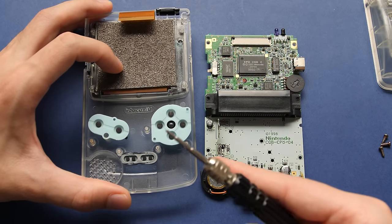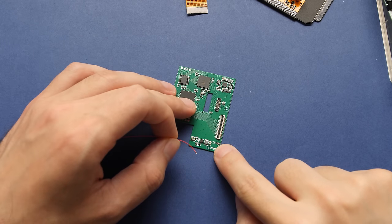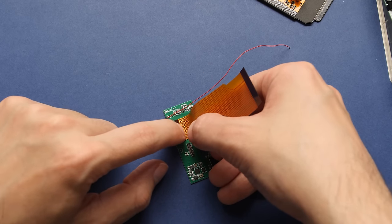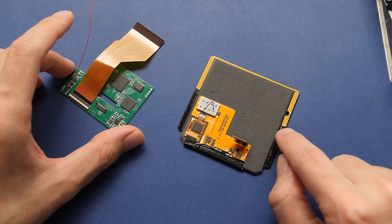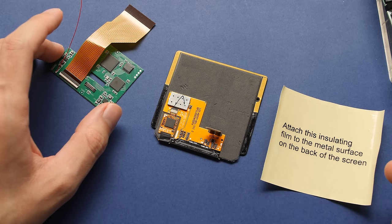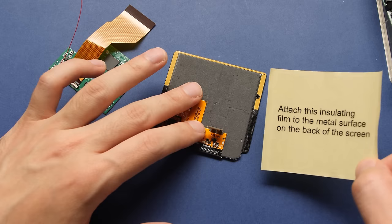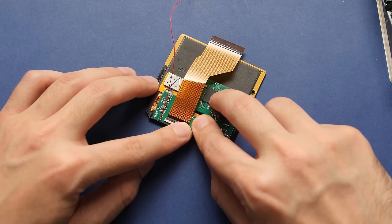For this build, I'm going to use everything that came with this $55 package. Now we're at the point where we need to solder this red wire to the battery point on the adapter PCB. They've already pre-tinned this pad, so it should be extremely easy to do. After we have that lead connected, we can move forward to reattaching the FPC to this board, and then plug in the new screen. You'll see that this one comes with adhesive strips on the sides of the screen. I took off the bottom half just to make it easier to get back in here if I ever need to. This kit also comes with some film to apply to the back metal surface of the screen to protect it from shorts, but the back of the screen isn't exposed in the kit I have, so I don't think we need to apply it. We're going to take the adapter board and feed the screen cable through the slot to connect the screen to the board, then slide the screen into place from the front.